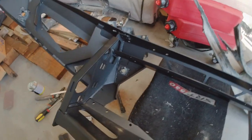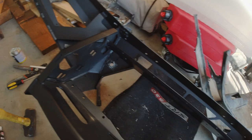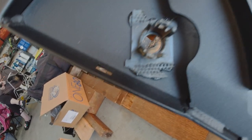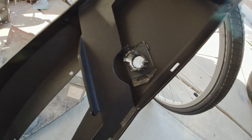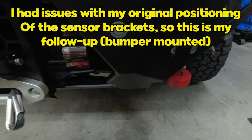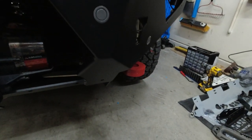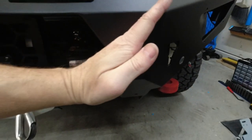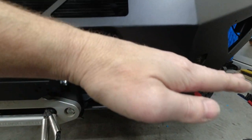For the sensors I was overthinking it. I basically took some JB Weld silicone sealant adhesive RTV and put it on the outside edges. There were a couple of places I had to cut so the sensors weren't being bent away from the surface. So far this seems to be working — worst case I'll redo them. Full-on success on the sensor front. On the stock bumper the sensor brackets are at different angles, but the sensors themselves were almost parallel to the ground in each case. I wanted to keep that as much as possible in the new bumper.